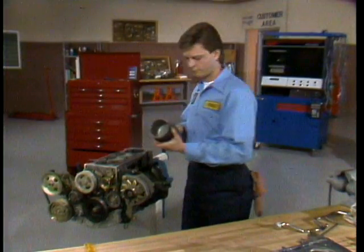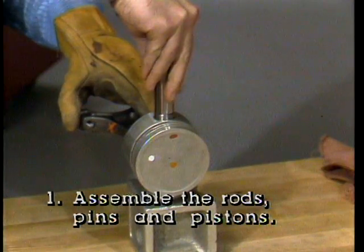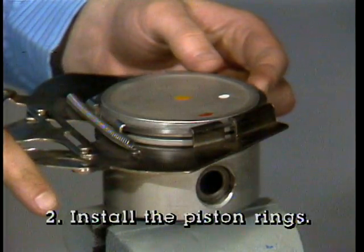And of course, we'll review how to remove the pistons and liners. Then we'll go through reinstallation, getting it all back together again. We'll get into new liner installation and arrangement, liner protrusion measurement. We'll cover how to assemble the piston to the connecting rod, how to install the rings on the pistons, then discuss putting everything back into the cylinder block. We'll cover head and gasket installation, what you have to watch for, how a diesel is different. We'll also touch on valve adjustment, unique on the J-type engine, and briefly on the engine's cooling system. So let's take our wet-sleeve engine apart and reassemble it.